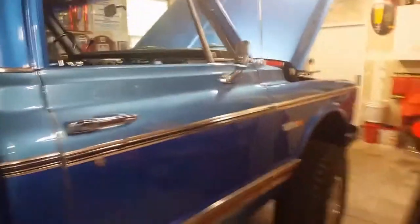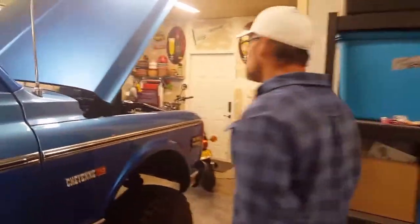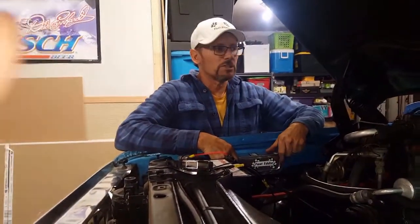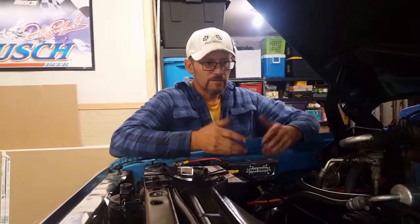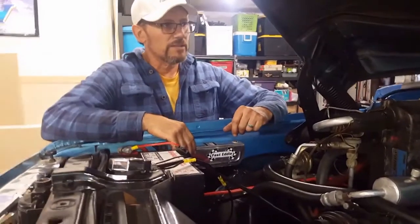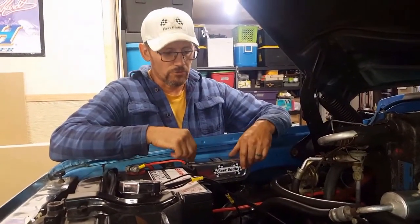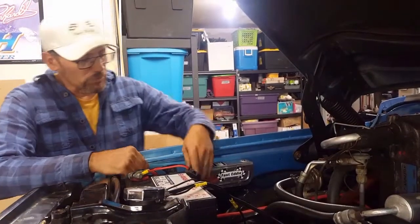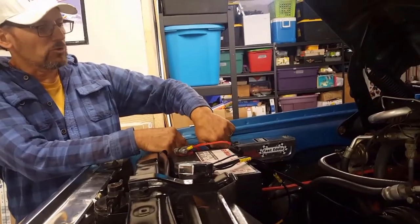Okay. So we'll go into the wiring underneath the hood. It's pretty simple wiring that comes with the kit. This is a module here that comes with the kit. It's underneath this panel right here. It's pretty small. They want you to just zip tie it somewhere underneath the hood, and we felt, you know, it needed a bracket and rubber grommet mounted, so that's what we did, and we built this cover over the top of it. The wiring is already pre-wired, plugs right into the module.